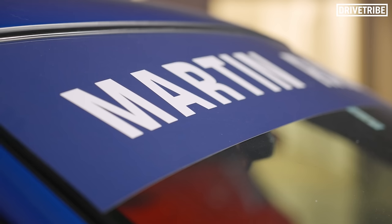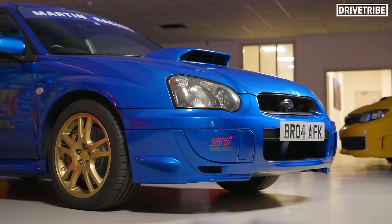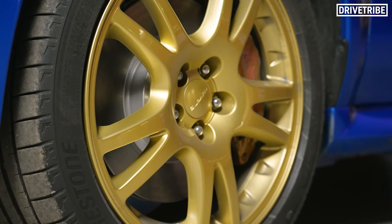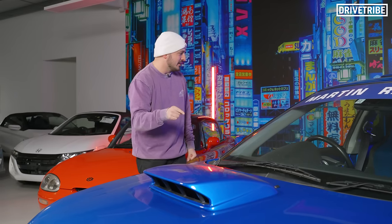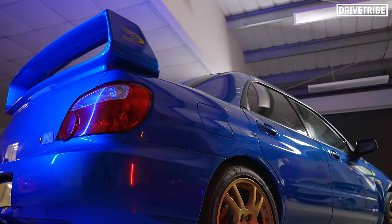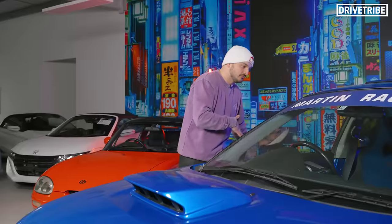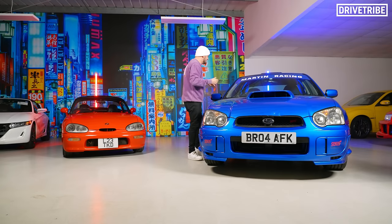That means that Martin is going to stay here at Torque GT for a bit longer. We sadly can't drive him away today because although a brake pipe should be simple, that specific one is hidden way in the car. It's actually incredibly difficult to see and it's corroded underneath the car's interior. We actually need to rip out half the interior to swap that pipe out. So it's going to stay here a bit longer and then we'll start creating content out on the road with him.